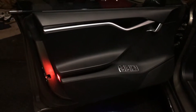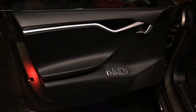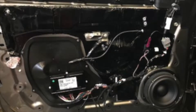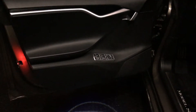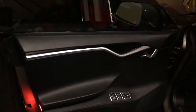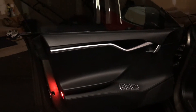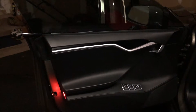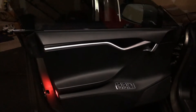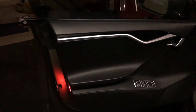Another thing that makes my car sound solid is something you can't see. If you decide to get an audio upgrade but don't want to spend money on a digital sound processor, that's totally fine. But if you do want new speakers and possibly an amp, I suggest getting your doors wrapped — especially if you want a subwoofer. My Audio Frog speakers are in the doors as well. The wrap is how you keep that sound solid. You know that rattling trunk sound you hear when someone drives by playing music? That means they didn't get the doors or subwoofer enclosure wrapped.